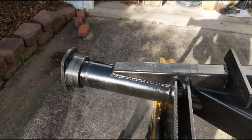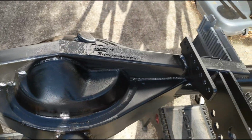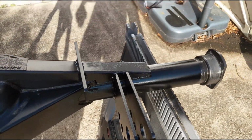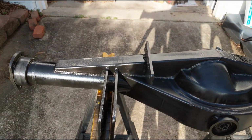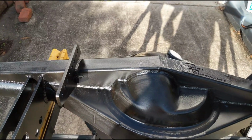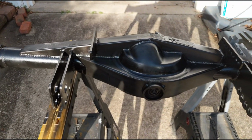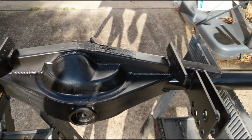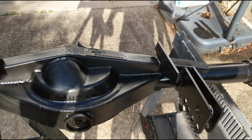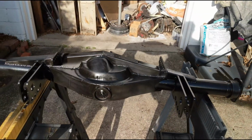All right, so sanded down all my fish eyes. Hopefully they'll cover up when I put some more paint on it. So we'll go spray a light coat, see if it's still fish eyes or not. If it doesn't, we'll keep painting. And if I get more fish eyes, we'll stop. It'd be nice to actually get it painted today. I think tomorrow's kind of like the last day it's warm here, and then all next week the highs are in the 40s, so really don't want to do any painting next week. So we'll get the paint shook up and start spraying here in a second.